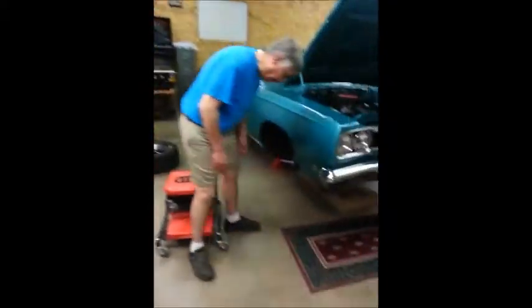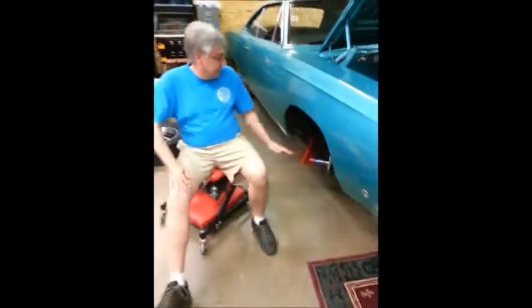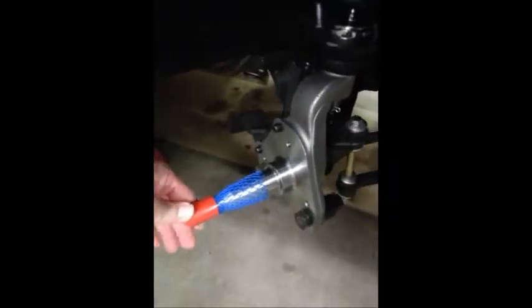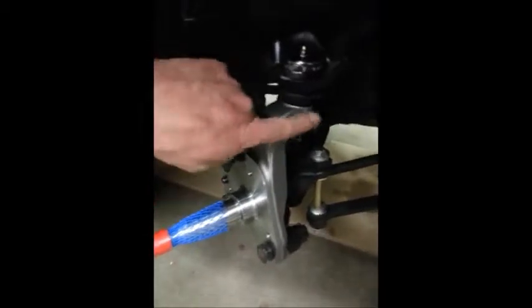Moving over to the car. Here's the finished work if you want to focus in on it. I didn't break anything. I've got the cotter pins in. Everything is torqued to spec, except what I said last night trying to get the torque up here to 100 foot-pounds.